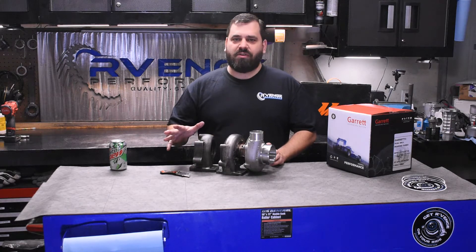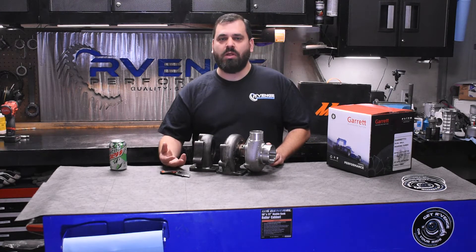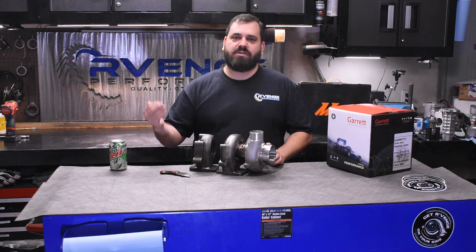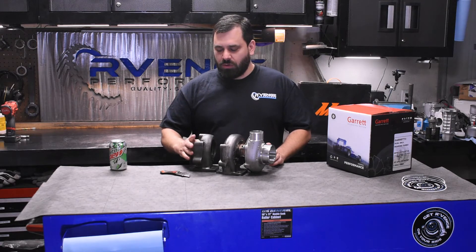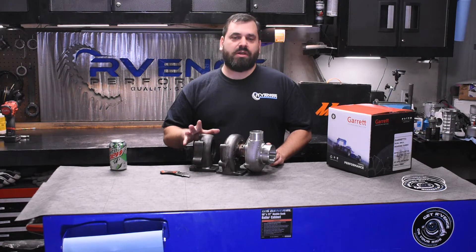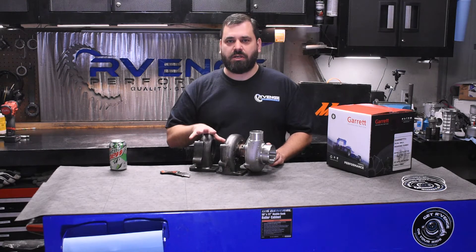It still would have been a lot of fun to drive with the manual, and we would have had no problems with re-spool. We've bogged the car to 2,200 RPM on launch before and seen it still recover to 16 or 17 PSI almost instantly. So it's really a great setup. On a 3.0, you may consider this 0.48 housing depending on your goals. If you want a really fast spooling 600 wheel horsepower car in the Garrett frame, that's a good option.